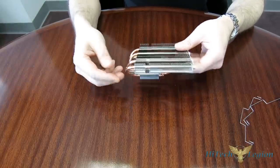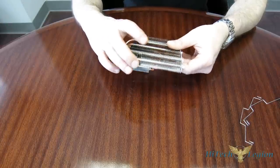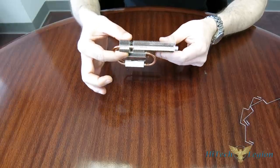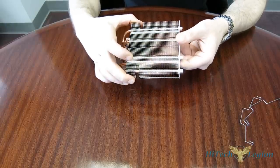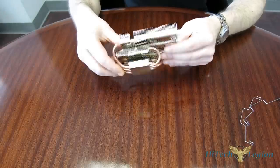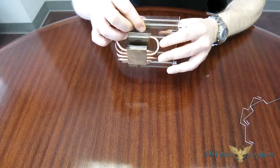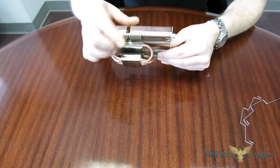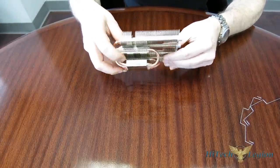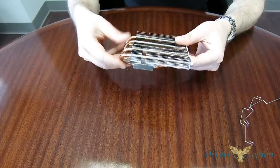All in all, four 6-millimeter heat pipes with two wrapping around through the fins. Very, very slim array of fins up top, so you do get a really short stature and it's going to look really good in the case. One thing to point out: you really don't have a whole lot in the way of RAM clearance, so you're going to have to keep to standard height RAM. Nothing with a heat sink whatsoever is really going to fit too well — something definitely to keep in mind.